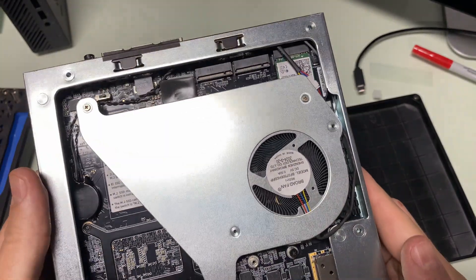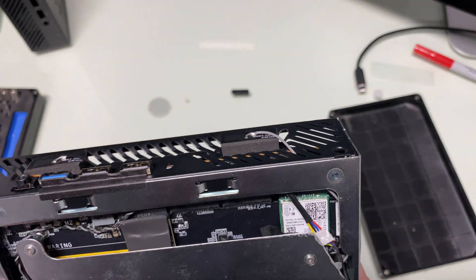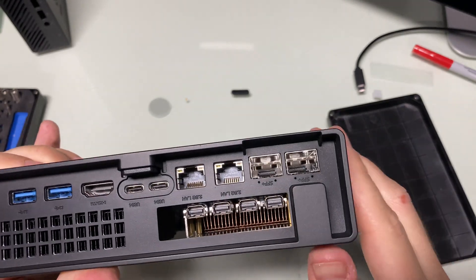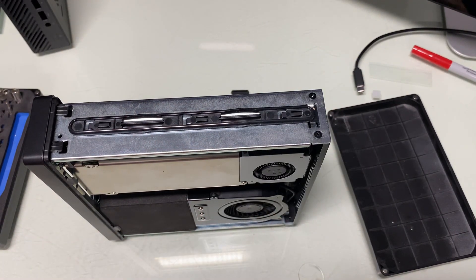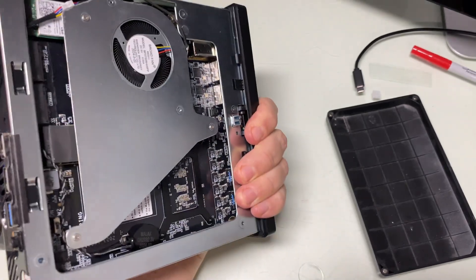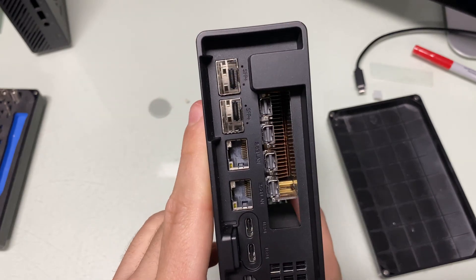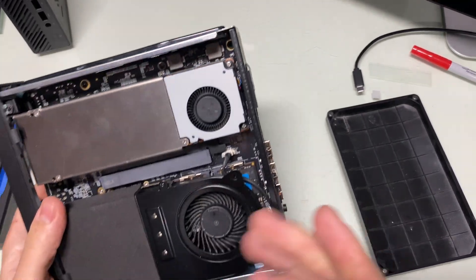Maybe we should also test-fit an 8 terabyte drive in here — that might be a nice upgrade too. There are no tiny mini DisplayPorts, but out of all the mini PCs, this guy is clearly hands-down the winner. I'm not going to make this video too long because the SSD upgrade and the CPU cooler PTM 7950 upgrade will be a separate video. This one is just the A2000 card installation, so we're doing one step at a time — I put the card in, boot it, make sure everything works, so we're not changing too many variables at once.